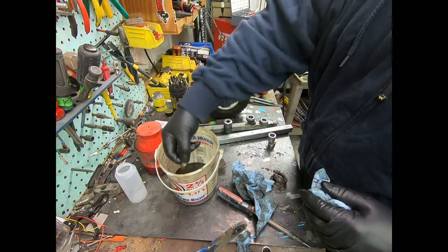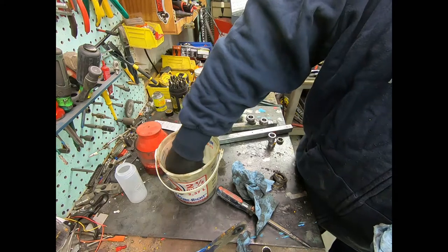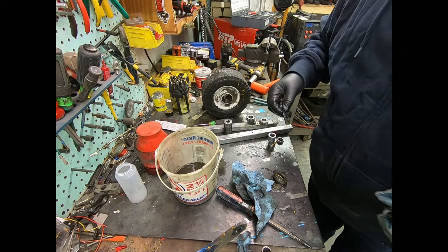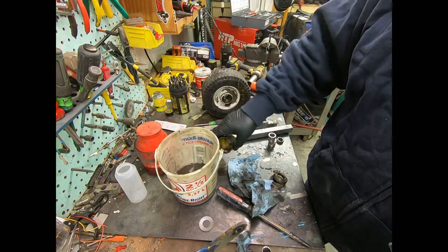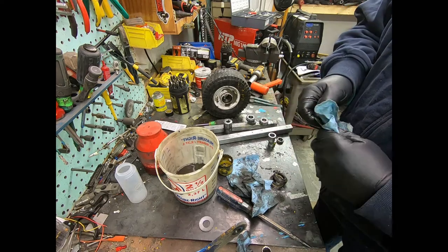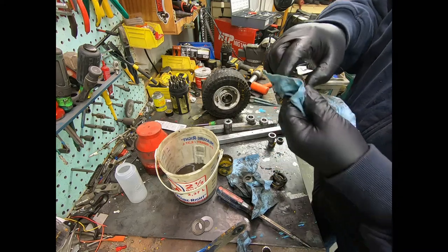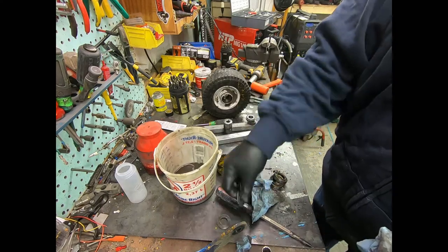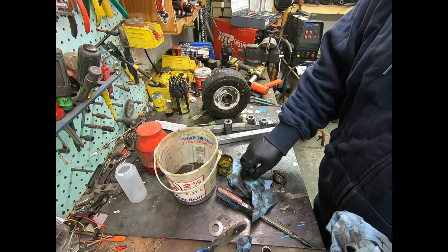There's a nut we're soaking — everything looking nice and neat when we put it back together. Pull out all the washers and clean them off. We've got to do some cleaning on the wheel itself — probably use some brake cleaner or carb cleaner to get all that nasty grease out. You can tell there's water in the wheel somehow — they're all rusty around the edges versus the top one, which is absolutely spotless. So somehow there was water. We'll make do with what we have.